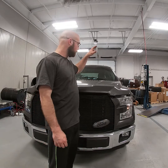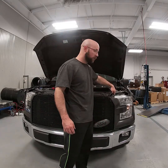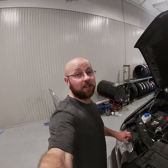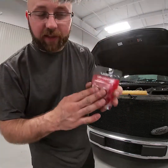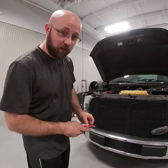We're at the front of the truck — obviously gonna have to pop the hood. I'm hoping I can get to them right here, and it looks like I can — super, super easy. You can see this one right there, looks like I can just twist — yes, that is fantastic, a lot less work than I thought. Now for these, the LED bulbs — the license plate bulbs which are no longer in the package — looked a lot like these except these have an orange tint. If you don't buy them at the same time, the back of them will say yellow, so make sure you use the yellow for the markers or else you'll have yellow license plate lights.